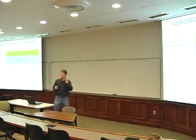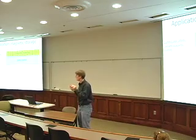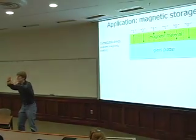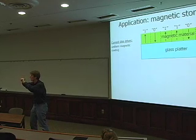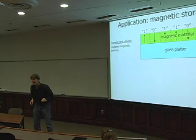It turns out, though, people are always trying to cram more stuff onto a hard drive, make bigger and bigger hard drives, but make them physically smaller. And one of the problems they run into is when you cram these bits close together, the magnetic fields tend to flip each other. You actually get a little crosstalk between the magnetic domains, which if you think about it is really bad for data storage, right?